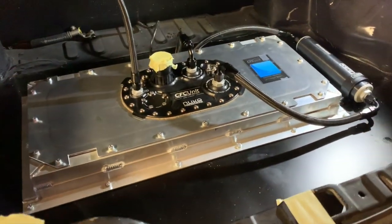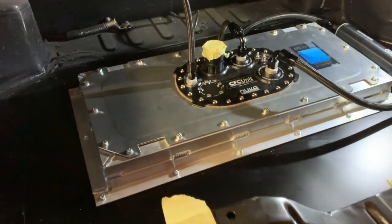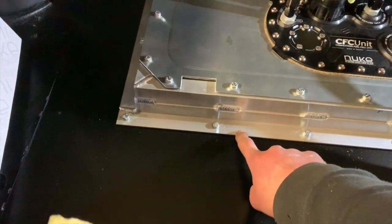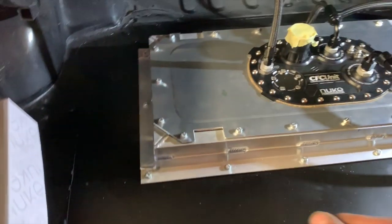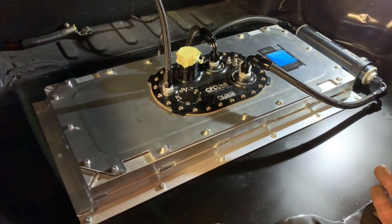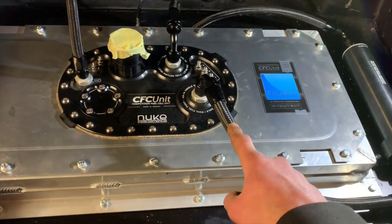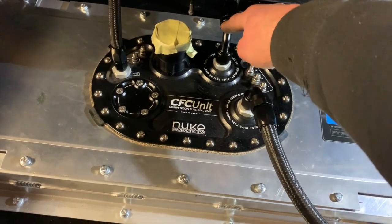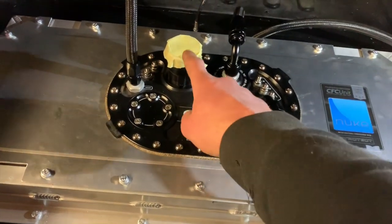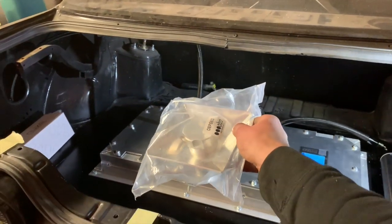So this is the top of the fuel tank as it's fitted now. It has got a riser installed just to bring it a bit higher from the floor, which is this aluminium part here. So the fuel tank sits into this riser and that bolts to the floor, which you probably saw from the previous pictures in videos that there's a big hole in the floor for it to go through. So the fuel quite simply comes out on this pipe, goes through the filter, down that one to the engine, then it comes back into the return, which fills the internal swirl pot. And this is for the remote filler that is on my to-do list, which will be somewhere that makes it easier to fill up.